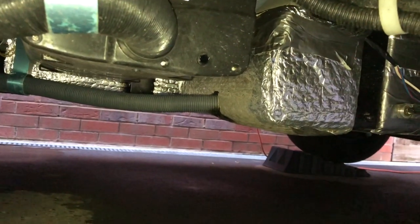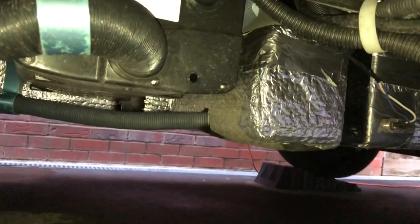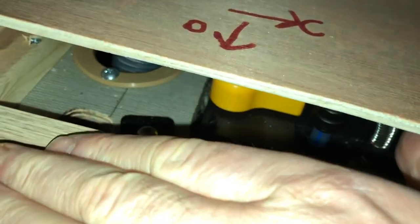Open all your taps individually on both hot and cold, because if you open the hot one it'll help drain the boiler down as well. If you see that little hole, that's the boiler drain. I'll just flip the yellow tap now — just literally rotate this tap.